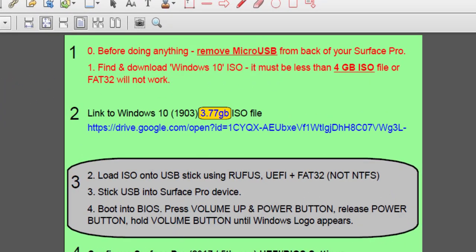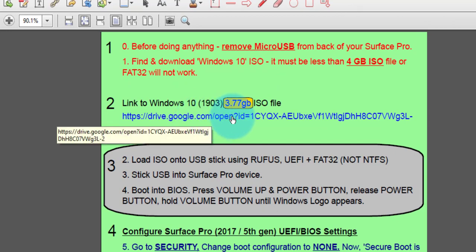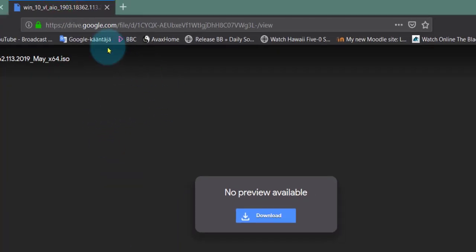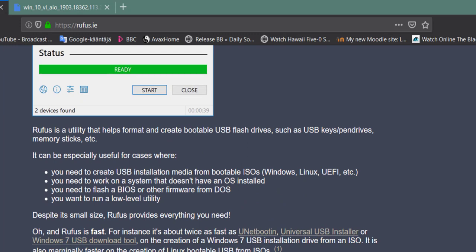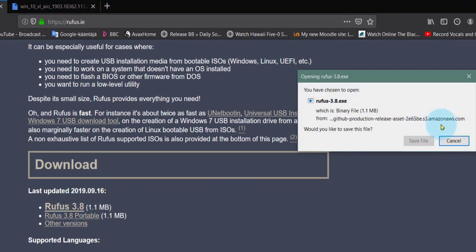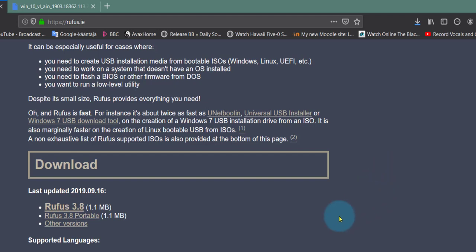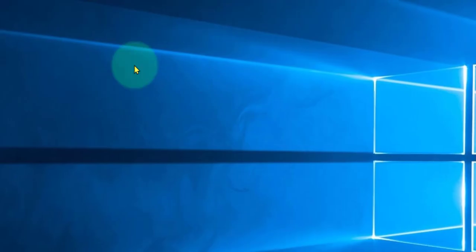Here is a link I've uploaded — this ISO file, because the one from the website is actually 4.6 gigabytes and that doesn't help us. So here's one that I found that works. Next we're going to load it onto a USB stick, then we're going to open the BIOS, and then install from the USB. Click on the link in the description below and that will take you to the download page. You'll also need to download Rufus in order to install the ISO on your USB. We are going to install this ISO onto Rufus as UEFI and FAT32, not NTFS.